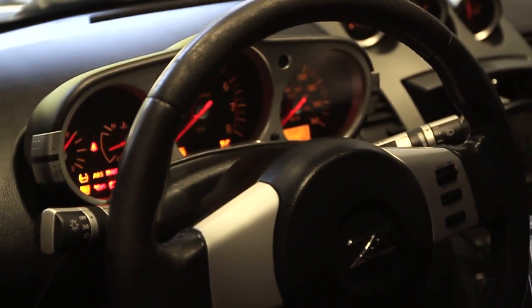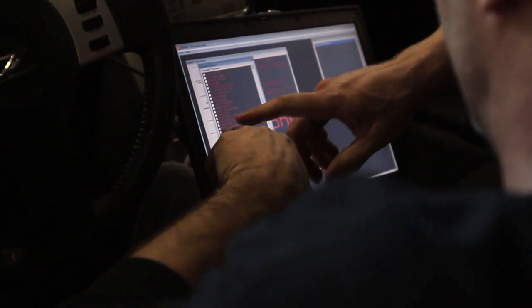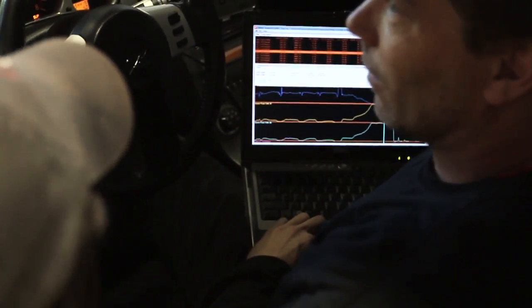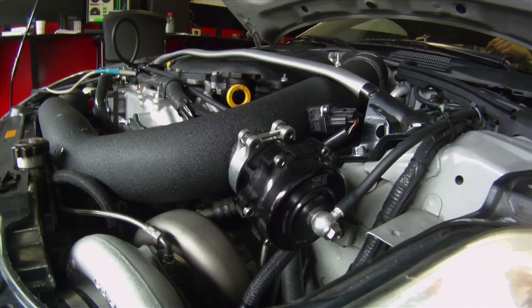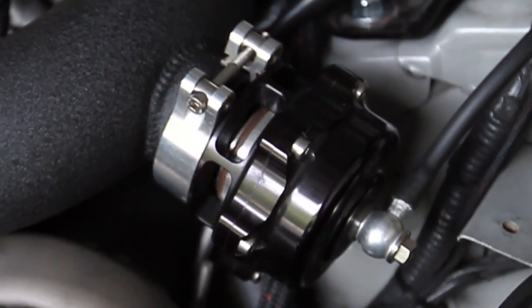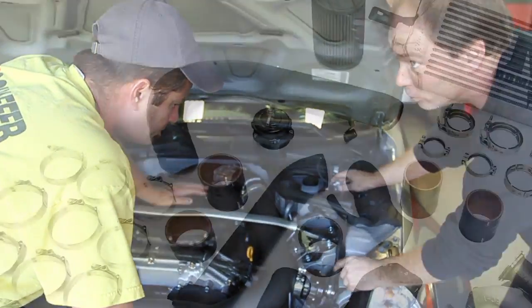An UpRev OSIRIS tune is supplied with the turbo kit, and this allows the installer or tuner access and data logging through the factory ECU. Not only does UpRev let the installer start up and drive the vehicle immediately following installation, but it allows the end-user OBD2 access to read and clear check engine lights. While we supply a base tune with the turbo kit, it's suggested that the vehicle be run on a chassis dyno to verify the tune following installation, and specifically verify the air-fuel ratios. The UpRev flash will allow adjustments to be made to the tune if it needs to be tweaked, or if in the future modifications are made to handle more power.